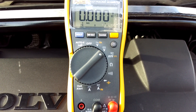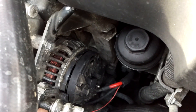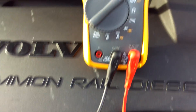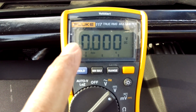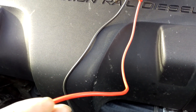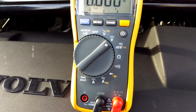You can also do a voltage drop test on the ground side by the exact same principle — just find a very good earth connection and ground the other lead on the alternator. To decide which end the problem is: if you have a positive reading on the display, your problem connection is whichever side the black lead is connected to. If you have a negative reading, the problem is more likely on the side the red lead is connected to. But once you've found a voltage drop, you're better off cleaning both ends of the connection just to be safe.